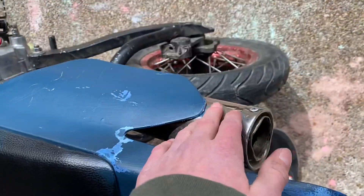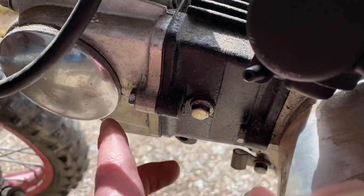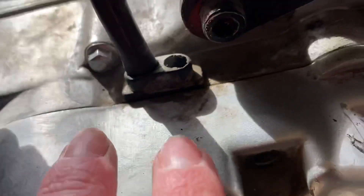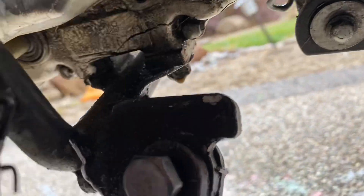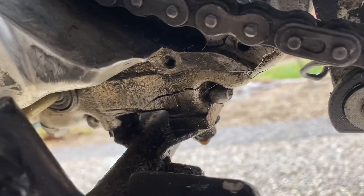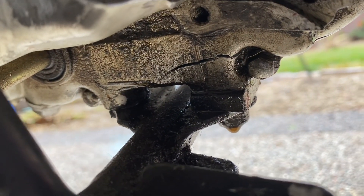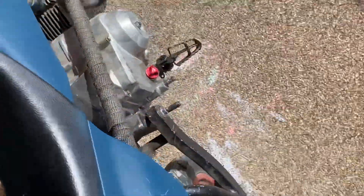Make sure there's a muffler on there, unless you don't care about one. Also look over the motor for blown gaskets, leaks, cracks, or JB Weld repairs. Look — I got totally screwed with this. That's my motor mount down there and I'm leaking all my oil out. Definitely not good if it's got a crack in it.